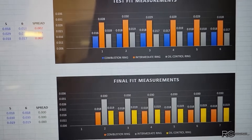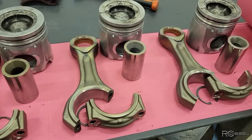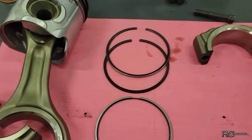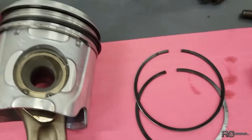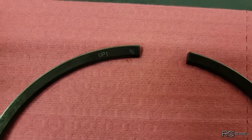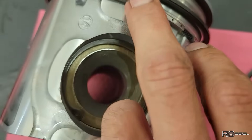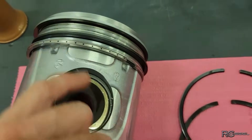So now I can put the pistons back on the rods and put the piston rings on. Pistons and connecting rods have all been run through the ultrasonic cleaner and then cleaned by hand. They've all been marked — the pistons are all marked for forward. On a diesel engine, your piston rings are not universal fit. It matters which ring goes in which groove and which way the ring sits in the groove. This particular set of rings are marked — it says up one, meaning this side faces up on the very first ring land. The second ring says up two, meaning this side up in the second ring groove — that's your intermediate piston ring. The last one is oil control and it says up three, telling you it goes in the third groove with this side facing up.